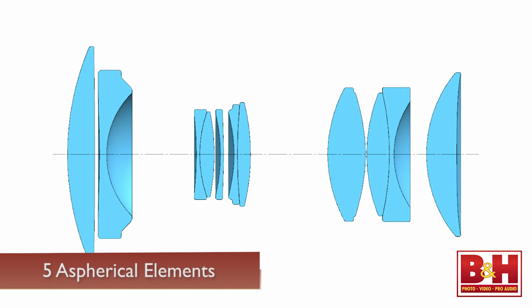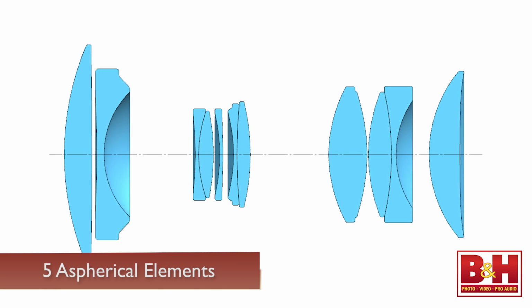And the tough part for us is how do we make a compact camera with that quality of lens with a micro 4/3 sensor and not make it very big? It required some real heavy lifting on our engineers' part to come up with some solutions. The biggest solutions are, this camera actually uses 5 aspheric elements. Glass elements, I might add. Yeah, no polymer in this one. They're all glass. And there's actually 8 aspheric surfaces, which means some of those aspheric lenses are aspheric on one side and then aspheric on the other side. And 2 of them are ED glass, so you're getting exceptionally high quality lenses here.